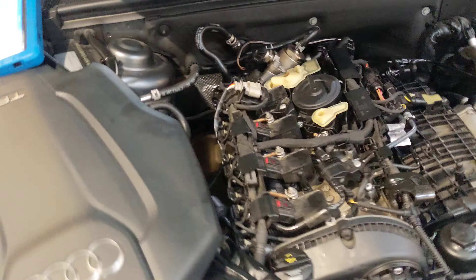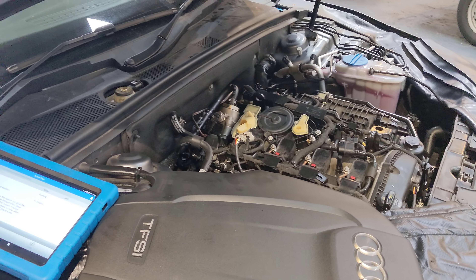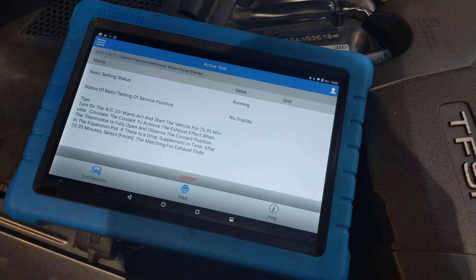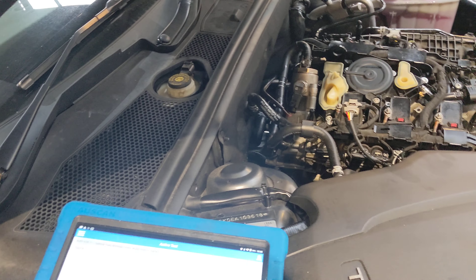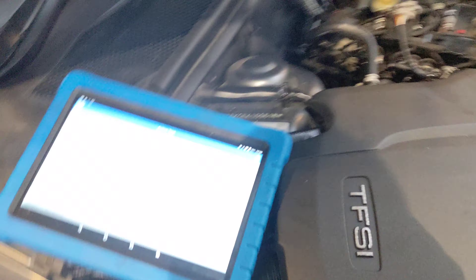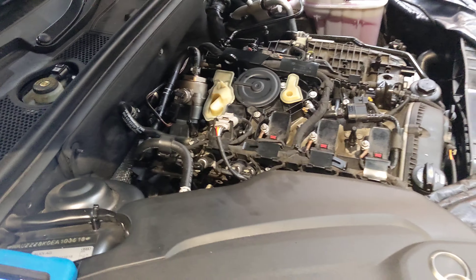We were thinking this guy's damaged his engine. This car had overheated a couple of times before. There will be an event where you might need to activate the auxiliary coolant pump to circulate and open the thermostat using a scanner. I've never had to, but today it happened. Hope that helps.